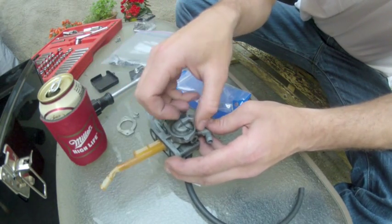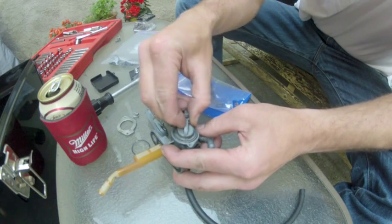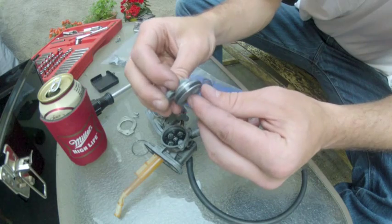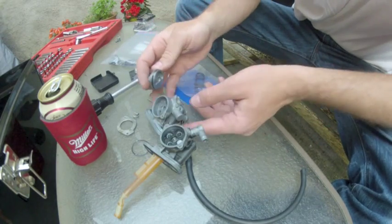See this leaf spring, when I put this one together, I tightened up this leaf spring a little bit to prevent it from leaking. This valve also has a whole new gasket around the edge that came with the K&L kit that seems to have fixed the leak out of the faceplate problem. It's no longer getting around this and down onto the bottom of the petcock.